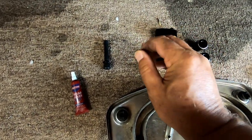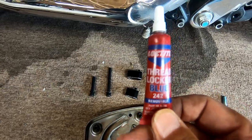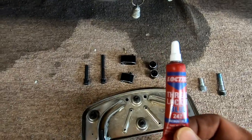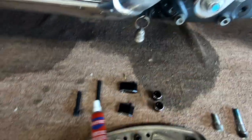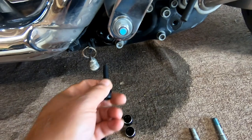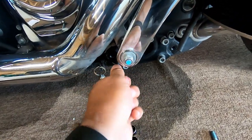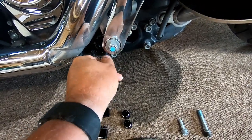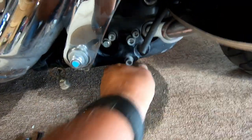You can get these lock washers on here — it's kind of hard to do while holding the camera. I'm also going to go ahead and use some blue Loctite, just a little dab on those bolts, just to keep them in the holes and keep them tight. I'm going to try to thread these first just to make sure the holes are okay. It looks like the same threads, though there's a bunch of crap in the hole. Harley apparently puts a lot of Loctite in their bikes when they put them together.